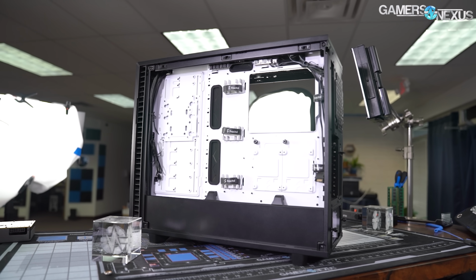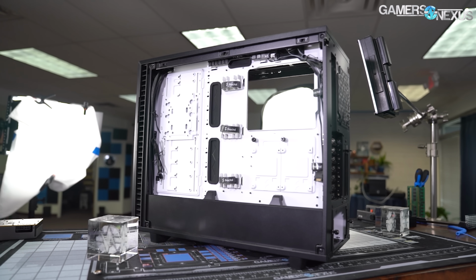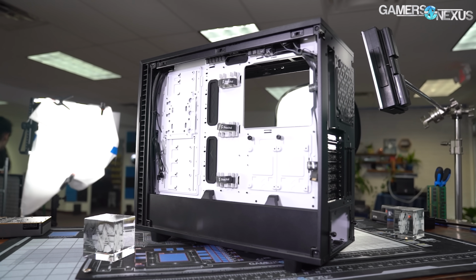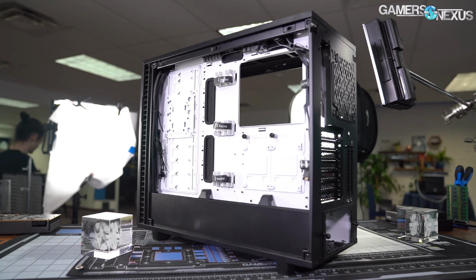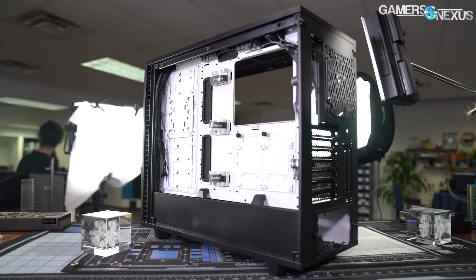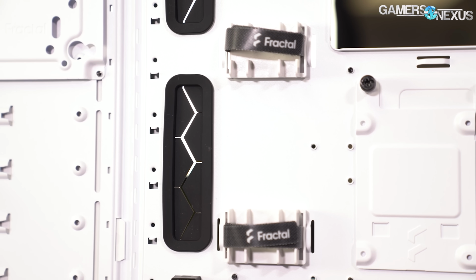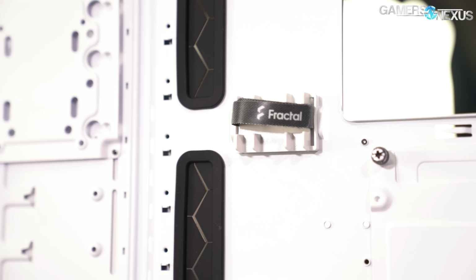The hub takes PWM input from the motherboard for speed control and draws power from SATA for power, obviously. We didn't use the fan hub for our tests because we need to monitor fan speeds individually for accurate testing. But Fractal gets points for hiding it away so effectively while providing 9 fan connections. The positioning is one of the best uses of the top part of this section of a case we've seen in a long time, so good job Fractal on this one.